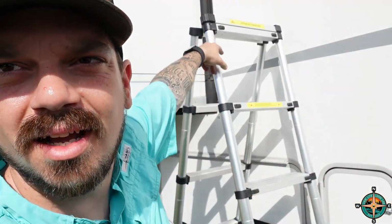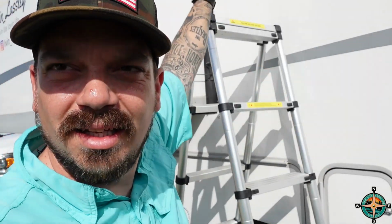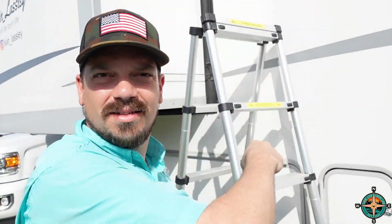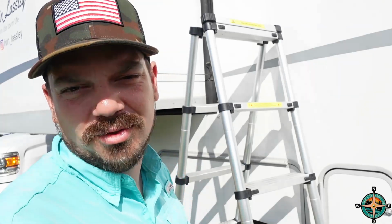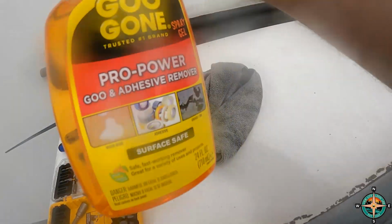So you could see that it's got 2 screws on each one going up and down the sides, and then it just pulls off, and then you take a little razor or something and clean off the rest of that sealant that they put on there, and then we'll take the Dicor and we'll just run a bead straight up it and smooth it out, and that's it. So I'm gonna do that on all the slides, and it takes a little bit to get that off, so it is kind of some tedious work, but it'll look better and it'll work.